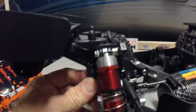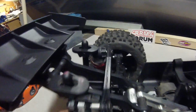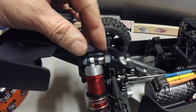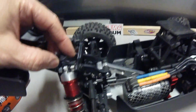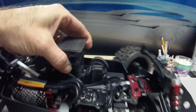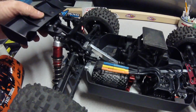On these rear mounts, just the way the bug body sits, I ended up using some of the longer ARRMA mounts that extend and curve up just a little bit. And then you'll see these basically almost rest on the cap here, which I don't think is going to be a big deal because I am going to make one of my little custom center body supports. For diffs, guys, I'm running my standard 50,000 up front, 200 in the center, 20,000 in the rear.